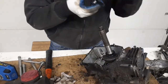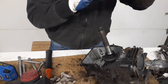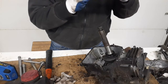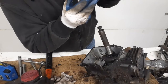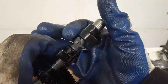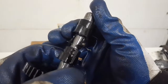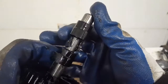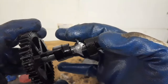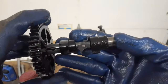Pull the cam — sometimes these lobes spin and I don't see that they're spinning. Compression release — well, there's a tiny spring but to me it seems to not be functioning. It seems like there's a spring attached that goes up, and — geez — is that it, or is a piece of it broke? That could affect this, because it should come off. But if that's the way it works, it doesn't seem to be very robust or reliable. I'll go grab another one from a scrap engine for comparison.